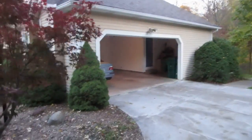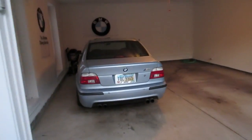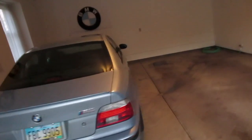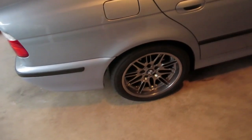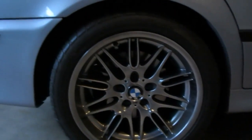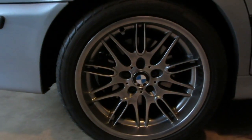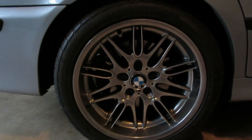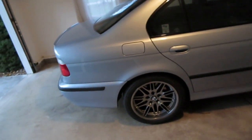I've been trying to get my parking brake to work for hours — it hasn't worked in months. From noon until about probably five, I worked on this. This is the corner, this is the problem area back here. So first I jack it up, pull the wheel off, take the caliper out of the caliper carrier, take the caliper carrier off, pull the rotor off. The rotor's held on by a six-millimeter Allen. On Kennan's car we stripped it, so on mine I hit it with PB Blaster and I was able to get it out without stripping it.